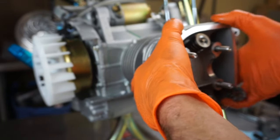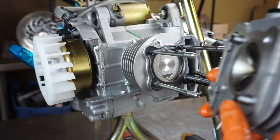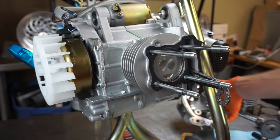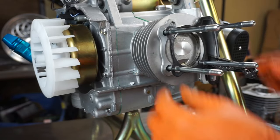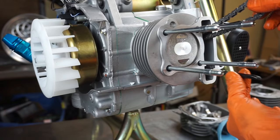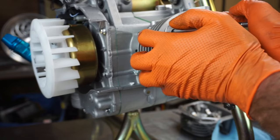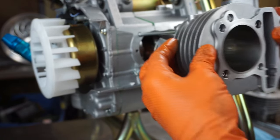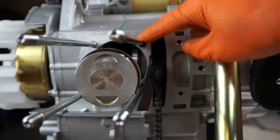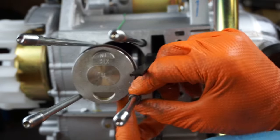Give the head a little wiggle and pull it off. Notice these dowel pins — there are two on the front and two on the back side. Set those aside along with the head gasket. Underneath is a timing chain guide — pull that out of the way. This motor hasn't been run even one mile, so everything looks brand new. Just give it a wiggle and pull the cylinder all the way out. Here's our old brand-new cylinder. Again, more dowels — one here and another right underneath.